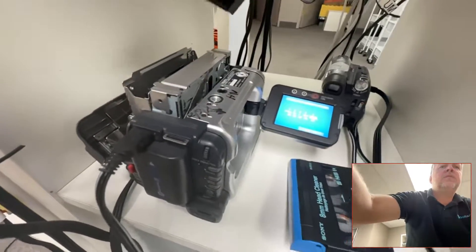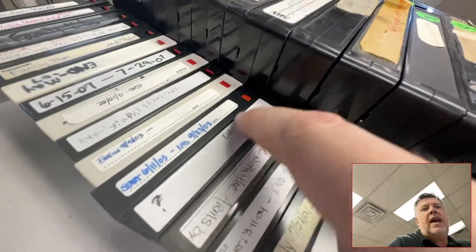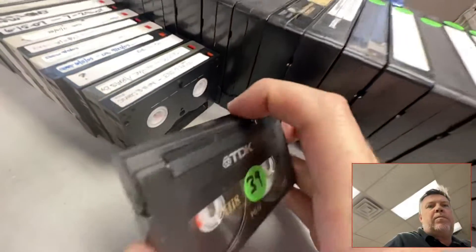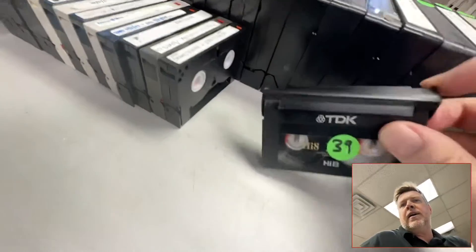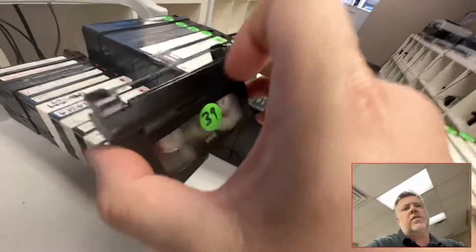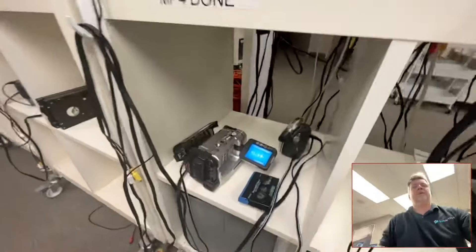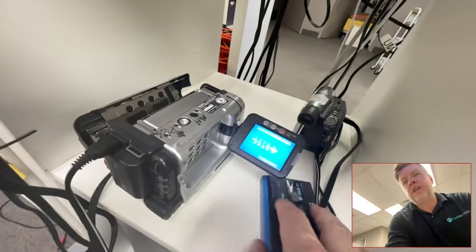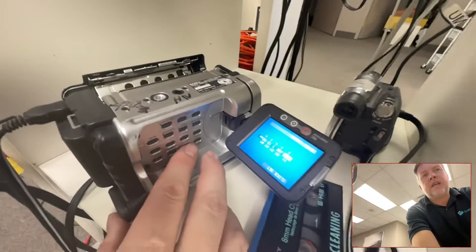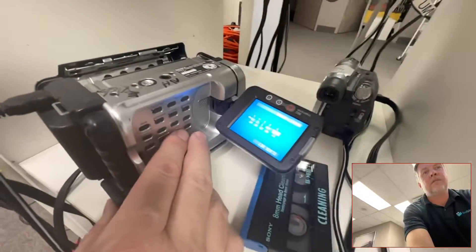Because this mechanism — all these little plastic and metal bits down in there — if you're trying to force the tape in or trying to close it, sometimes stickers on the tapes, if they're over the edge or on top, can impede the door from peeling back. You want to investigate why it's not closing, otherwise you're going to break stuff.